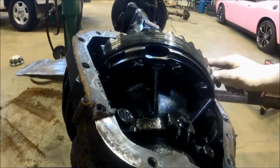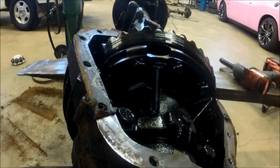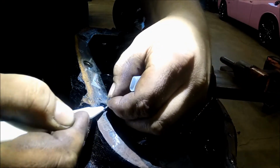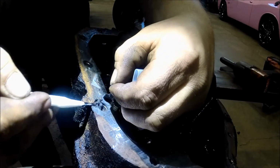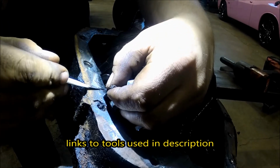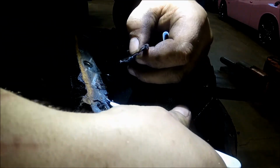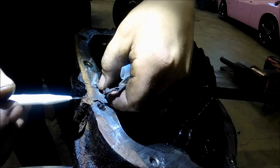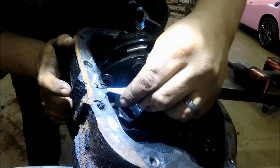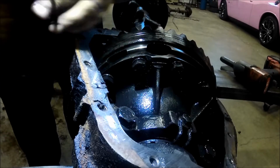So what we're going to do to change that is use a little thing that's used in the medical world, but it bites on very fast, and it is actually a scalpel. You can see using a scalpel, they're razor sharp, and they just dig right down, and you can precisely knock down all the gasket material that's on this rear end, and any other material too. I mean, they just cut right down where you need. So you can get my hands out of the way there. You can see you can just get right up underneath this, almost go right down to the material.